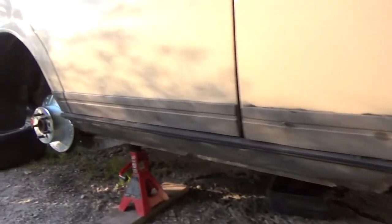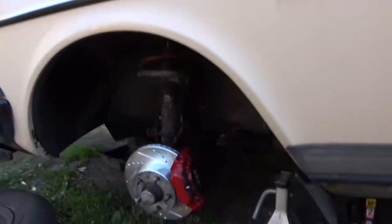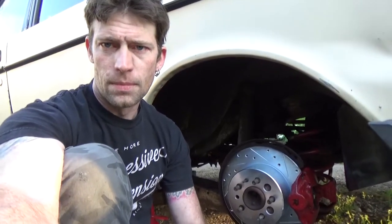One brake. Two brake. Three brake. Four brake. So Stephanie and I bled out all the brakes. I didn't show you that part because, well, by now you know how to bleed brakes, right? Even if not, the important thing is that unless you have a one-man bleeder, you want two people. There's a bleeder screw, you put a clear hose on it into an empty container, and you have someone press the brakes until there's no more air.